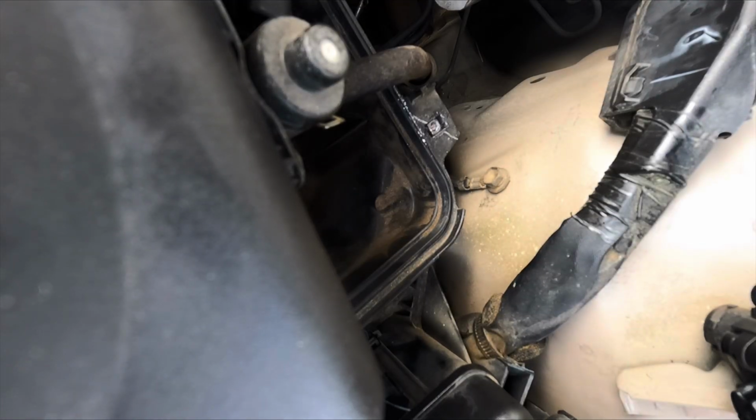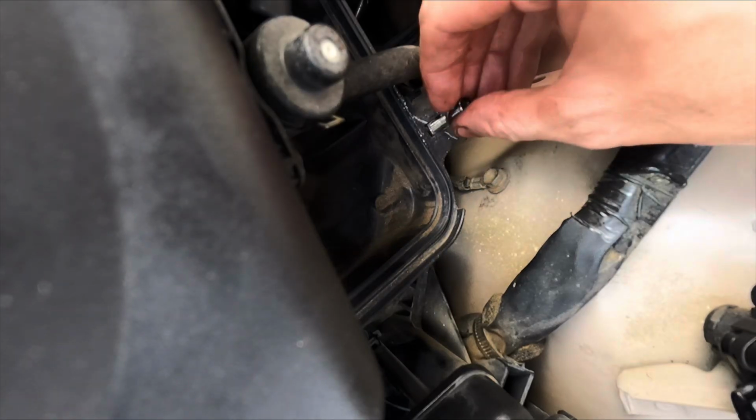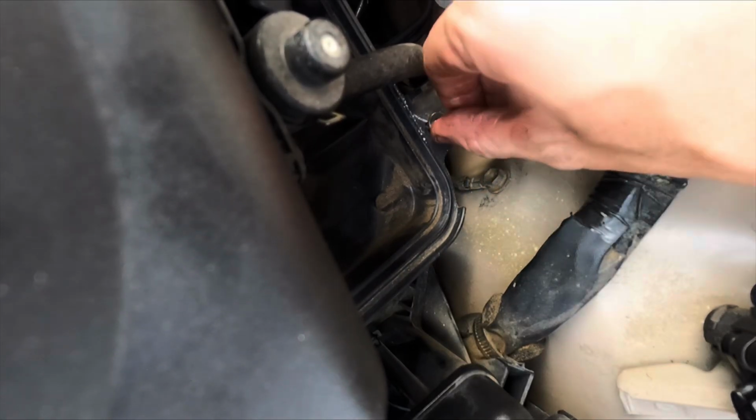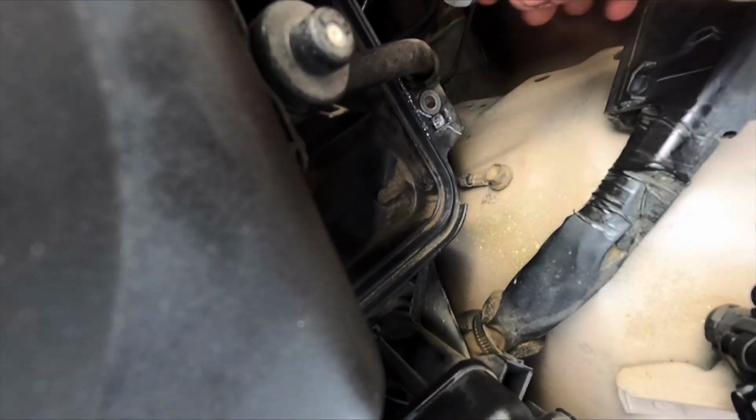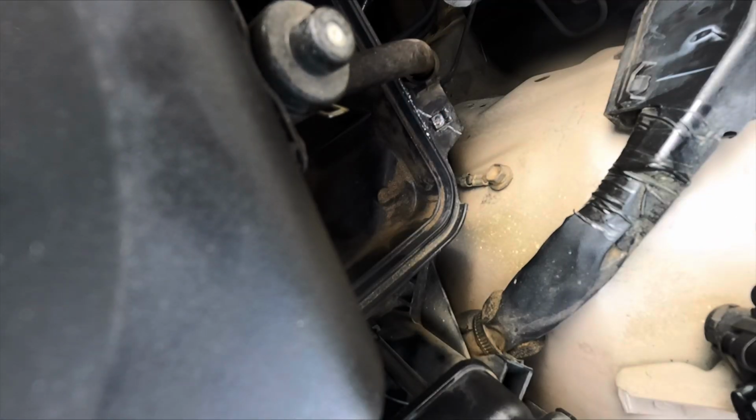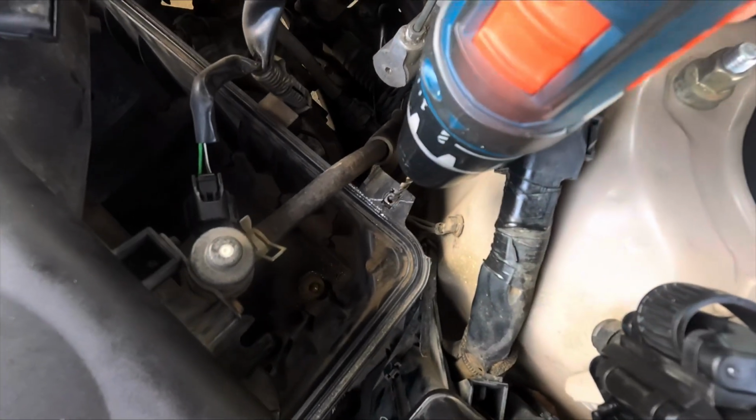So what I do have is another screw here. I'm going to just try it and see if it fits. Not quite, of course. That's probably just because I've damaged some of the threads. If I did have a tap, I would re-tap it and clean it up. But maybe what we do is we just drill a little bit larger of a hole, clear the threads all the way through, and then we would be in a good place here. So let's go for an 11/64 drill bit.